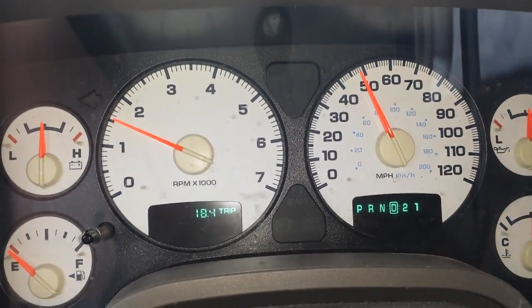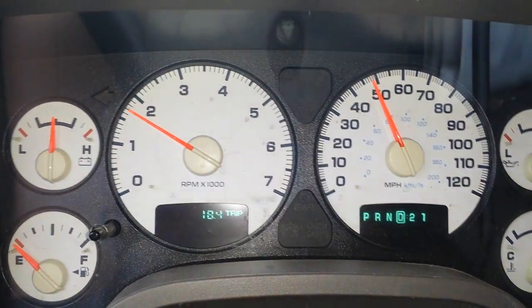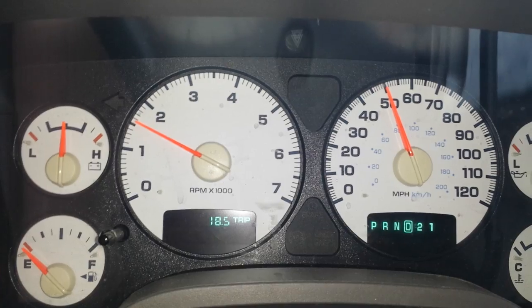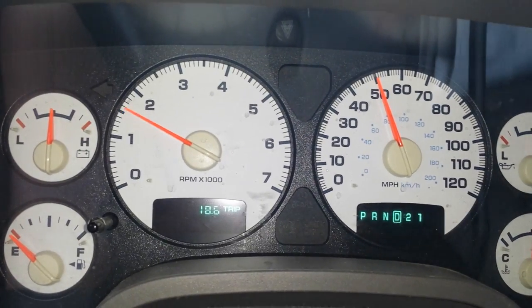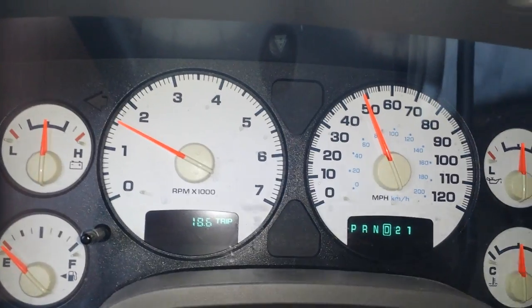That is the mystery. I've solved the mystery of why the ABS and parking brake lights are on, at least in my situation. And I think for most people with these model years of Dodge trucks, it's not actually the sensor. It's the sensor getting fouled up by metal shavings from these retainer clips in the differential. Good luck. I know I need it.